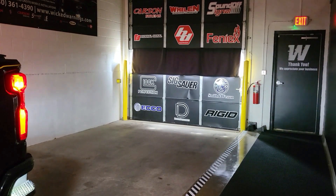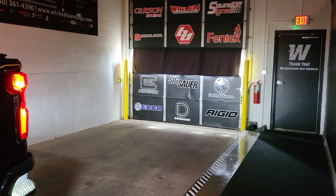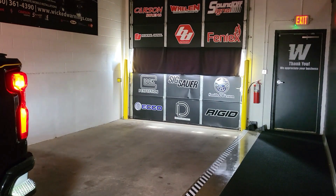Here's a back shot of about how much light that's actually putting out. It's sufficient to light up a two-car garage if you're backing in at night, but it's not going to do a whole lot more than that because it is just a couple of M-Power lights. If you're looking for much larger, brighter backup lighting, you could take a look at some of our Baja lights — like an S1, S2, or our SS3 — and they are sole-purpose floodlighting. They do not do any warning; they're just white lighting. When you need a bigger volume of white light, you have to get away from the dual-purpose light and go with a steady flood, purpose-built-only light.